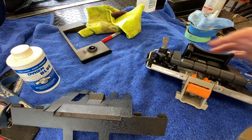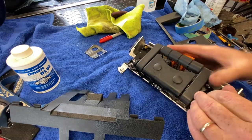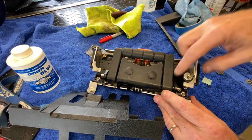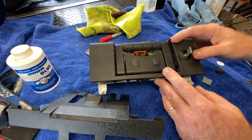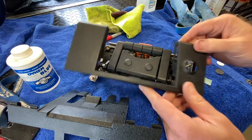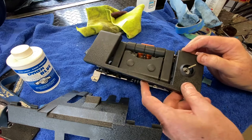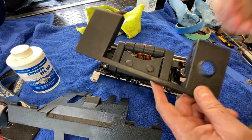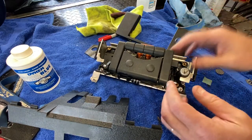You can pop these off in literally a minute or two or less. The only caveat is the top one here. When you have this in the closed and locked position, you can't pull it because this little tab is in the way, and it locks over through another mechanism to keep this from opening while it's locked. Of course, this goes over here and snaps in. The only way to take this off — because it has a slot that engages with that tab — is to have it in the open position. Well, you can't take the key out in the open position. So what ends up happening is you're going to have to pop this up away from that slot, then turn it and re-engage it to the slot, and then pull it up with the key. I happen to have this skinny duplicate key I had made years ago, so I just left it in and it came up over the top of it.